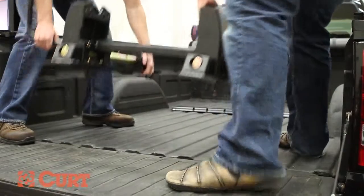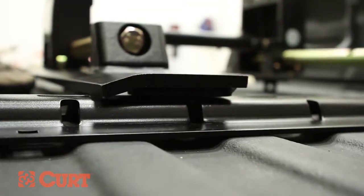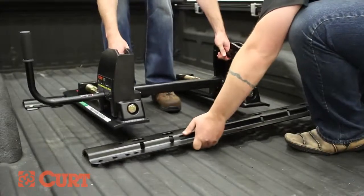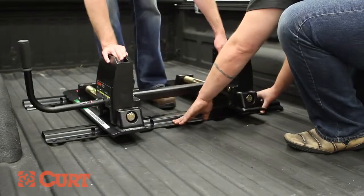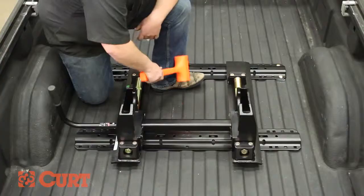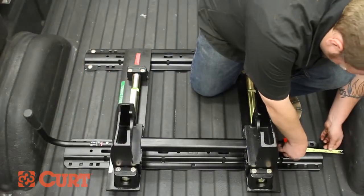Next, we will position the rear mounting rail. To get the exact location, place your Hitch product into the already installed rail. Then position the second mounting rail by inserting the foot tabs into the base rail slots. To reduce the possibility of chucking while towing, tap or push the rail tightly towards the front or rear of the vehicle to ensure a tight fit.